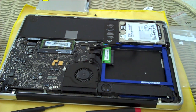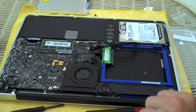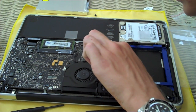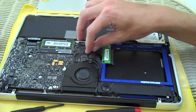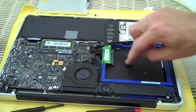The Data Doubler installation is pretty much done. Just make sure you got that clip on right and the screw goes in — mine was upside down, but I just took it out and switched it. Got the cable installed here. There are two connectors: the one closer to the battery is where the hard drive plugs in, and the one right here — where the optical bay used to plug in — is now the hard drive bay.